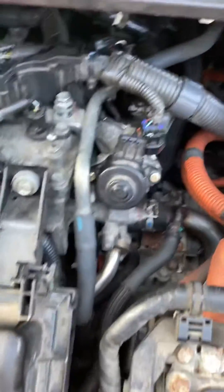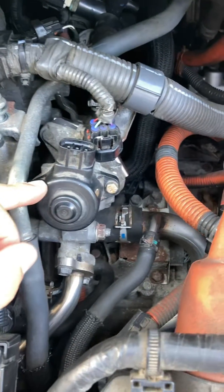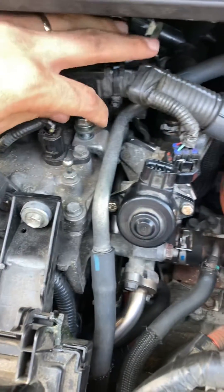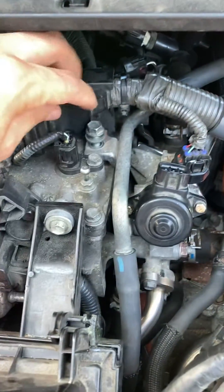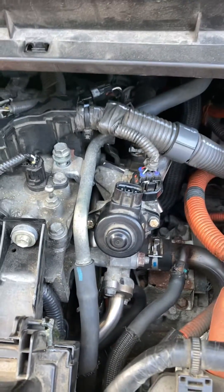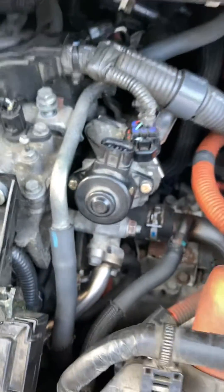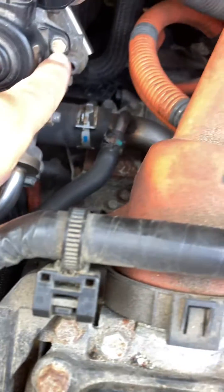This is a really quick way of approaching this EGR unit, especially for taking off the EGR valve. Loosen this bolt so you can move this thing around — you can even take this bolt out using a 12 millimeter. Once you take this bolt out, this part moves so freely.